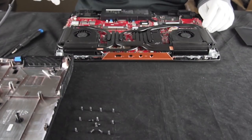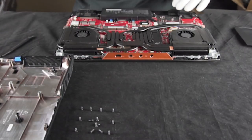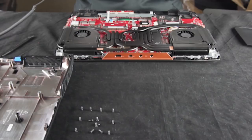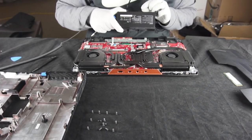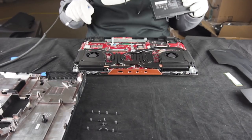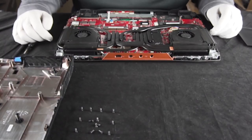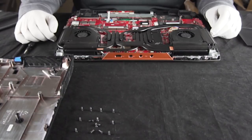Now that we're here, the first thing we're going to do is remove this battery. It looks like it's all unscrewed except for one. The battery's going to come right out. I'm going to put that screw back in the screw hole, which is actually marked for you. There's a little triangle that marks the one screw that comes out with this, so keep that together. What it appears is that this whole thing is going to be a board flip, which is a super huge pain — that's why we're going to do it instead of asking the customer to do it.